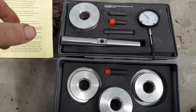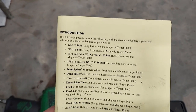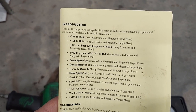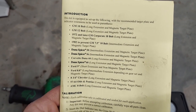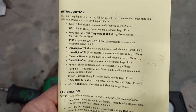This tool is only good for 10-bolt, 12-bolt, Dana 30, Dana 36, Dana 44, Dana 60, 9-inch, 8.8, and 8 and 3/4. So it covers a lot, but doesn't cover everything. You can probably make something up to get it close, but this is what you've got.